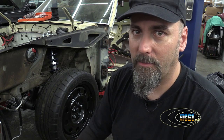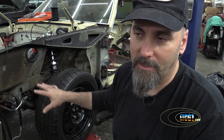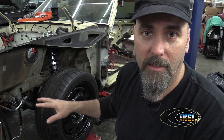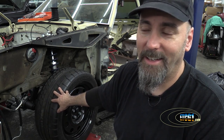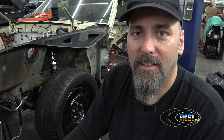If you're advocating new wheels, I've already thought ahead of you. If I get this car to a track and the handling feels squishy through corners, what I'll probably address first is getting wheels with less flex — alloys, for instance. Of course, that ruins my sleeper look for street driving. For the most part, this car is going to live its life on the street with two modes: a track mode and a street mode. I'll accomplish this basically by shedding weight — dropping 200 pounds, removing the bench seat, putting in a racing seat. So it'll have track day abilities, but mostly it will be driving around on the street, and unless I'm excessively exceeding the speed limit, this car is going to be perfectly safe.